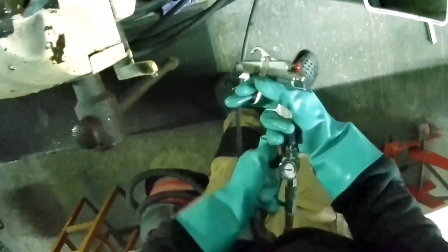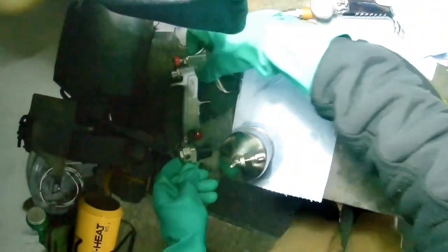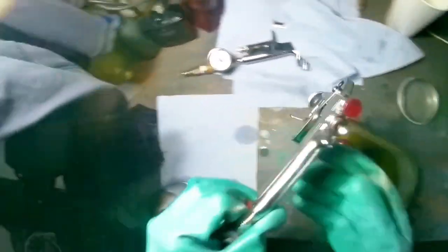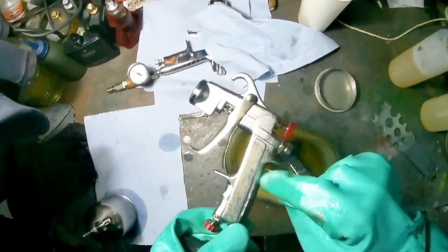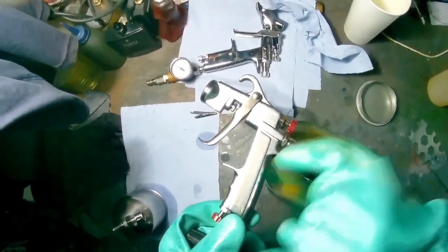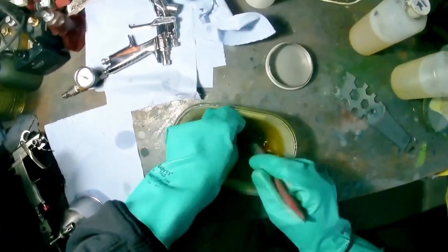Turn the air pressure up if you want. That just makes sure it's all flowed through the gun. Leave the gun facing downwards - we don't want thinners entering back into the gun because it can cause problems with the air seals. Also if you've got guns with electronic gauges, that causes problems with the actual gauge. So always keep it facing down. Sata in fact recommend plugging it in and keeping a small amount of air running through while you're cleaning, though I've never found that necessary and all my Satas with digital gauges still work.